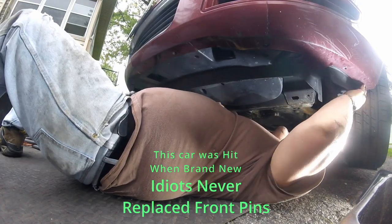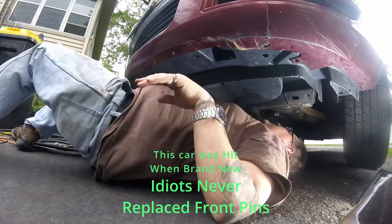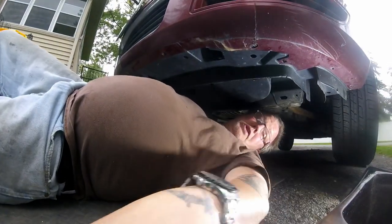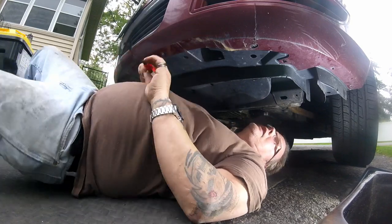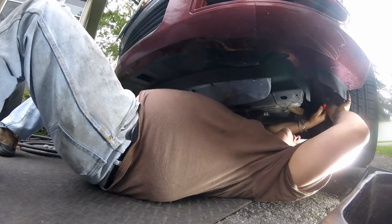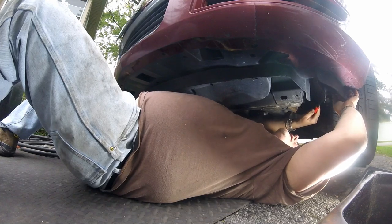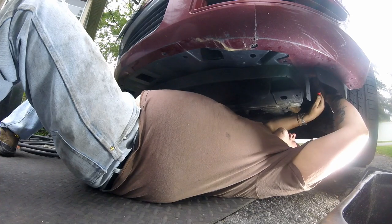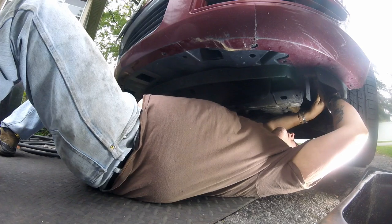All right, now these other ones that are on the fender well liner are going to have to pop out. I don't know if I showed you the tools I brought out, but these are handy to have. These little body clip tools, you can get right under the pin and pull out the center pin. Sometimes. Yay, it worked. There's a little recess on the side where you're sometimes able to get a start on it.